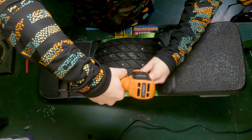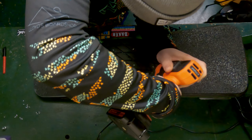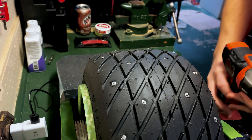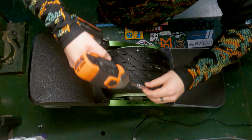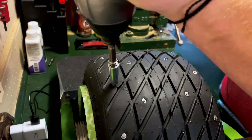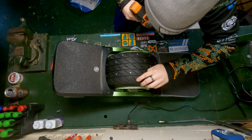If you get one that goes in a little bit too deep, you can back it out just a little bit and it should be fine. Sometimes they're stubborn and they don't want to bite quite right, but just keep at it and they'll sink in nice. I like to always have the stud I'm putting in at the top of the tire so I'm not fighting the side and rolling everything around — just so that you have nice even pressure pointing downwards. Sometimes they'll bite right away; sometimes you've got to fight with them.